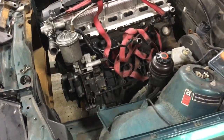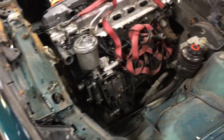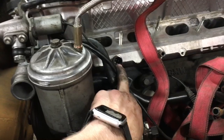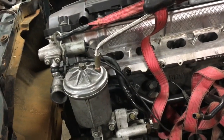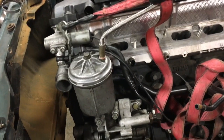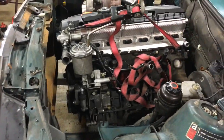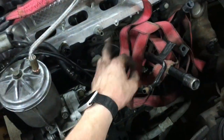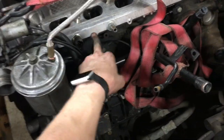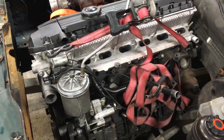It's not even sitting close without the engine mounts, so I have to do something about that. Another thing I noticed is that although it's a 1997 engine, it has the 1998-style coolant sensor housing. The E30 runs a one-wire brown gauge sender and the ECU sender is compatible, but I'm not sure how the previous owner handled that since this was converted to OBD1. A lot of people will tap it out and put a sensor in there, or drill and tap, or use an adapter lead if running an E36 — but since the E30 isn't electrically compatible with that, I'm not sure what the best option is.